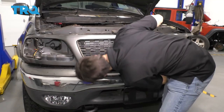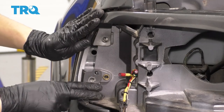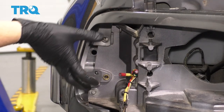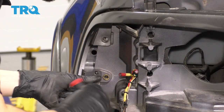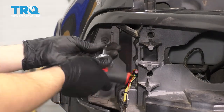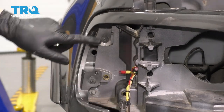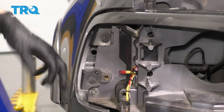I heard one click — second click. On each side you'll see these pins here; that's what these need to line up with. I'm going to put these two screws in so that it stays secure on this side, then go to the other side and line it up so that when I move it around it doesn't pop off. Nice and snug — don't go too tight. These are screwing into plastic and you'll either break the plastic, strip it, or break these tabs. So nothing good, basically.